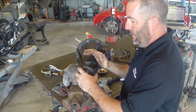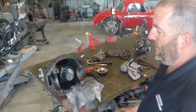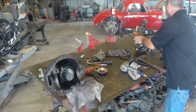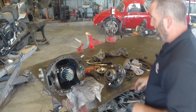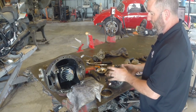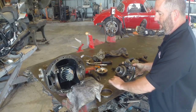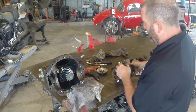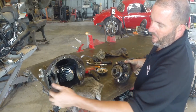Granted if we put new bearings it'd be much tighter, but used bearings always go a little bit less. Let's spin this guy around — we've got to put the back end of this thing in. All my right stuff is on the right, left stuff on the left. So all we've got to do: slide this guy into the carrier partially, put this race on this side, this nut on this side, this race on the other side, this nut on that side — stab the races into the smooth parts and the nuts into the threaded parts — stab the fork onto that little sleeve, all at once without dropping anything, and then install these bearing caps.